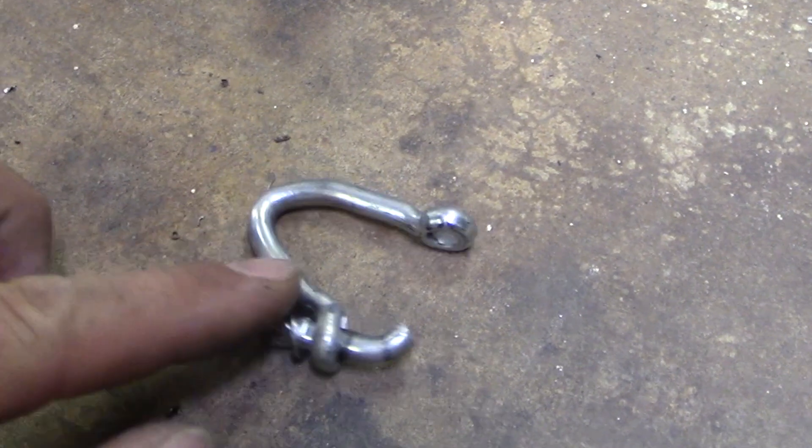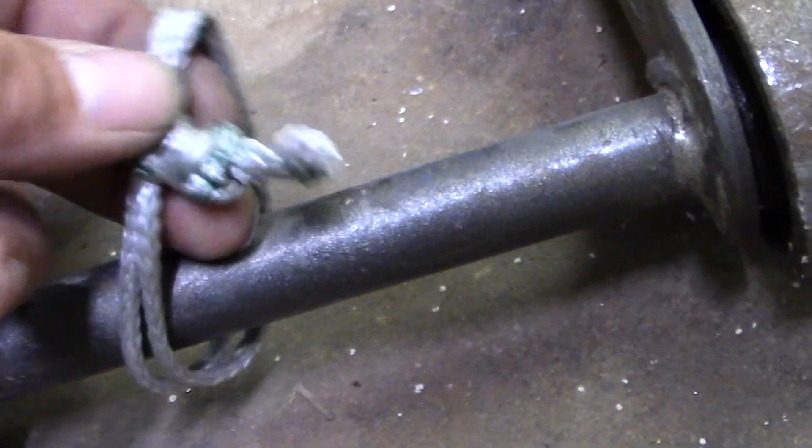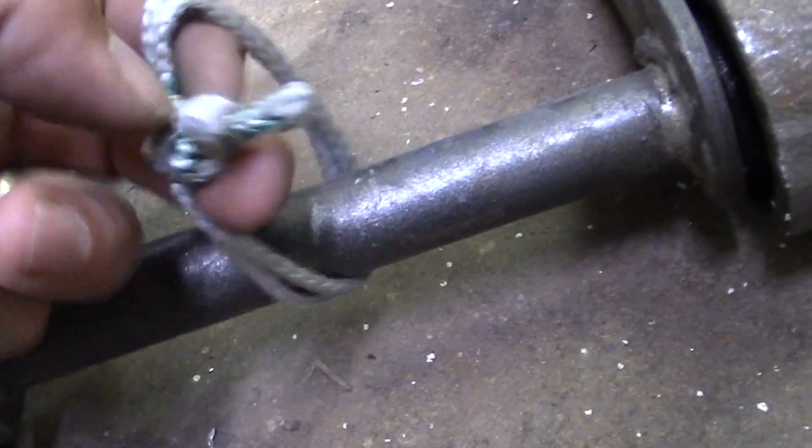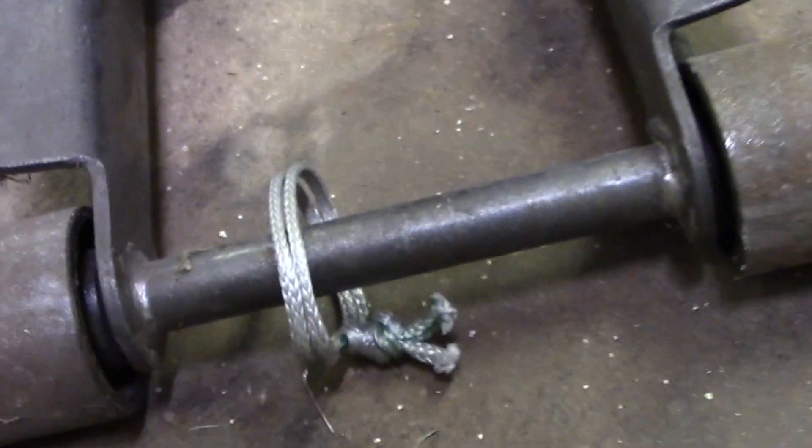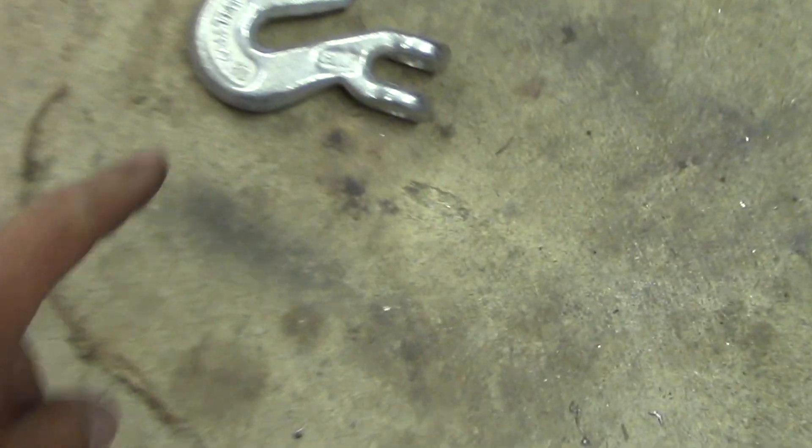Safety first. Let's look at what we got here at the scene of the accident — I've not touched anything. We're gonna have to find a few pieces. We got the shackle laying right here — it broke at the threads and bent the edge back. Soft shackle number one is fine, there's no damage. You could probably reuse it. Soft shackle number two shot up through the ceiling — the part that wasn't secured shot out like a slingshot.